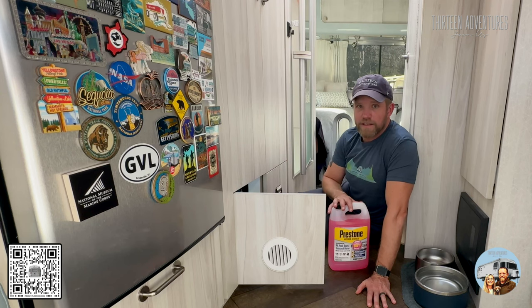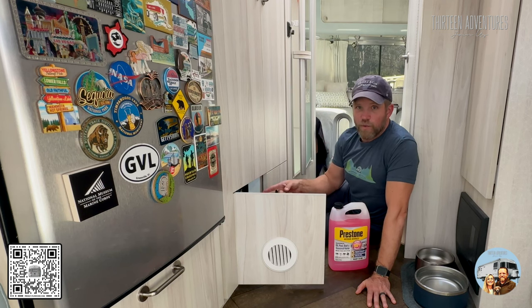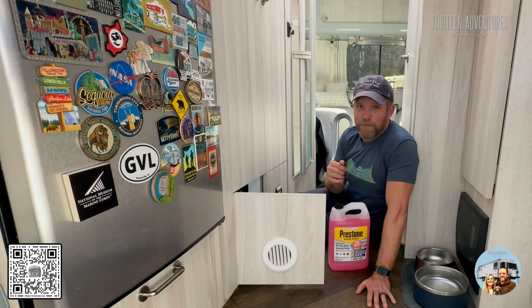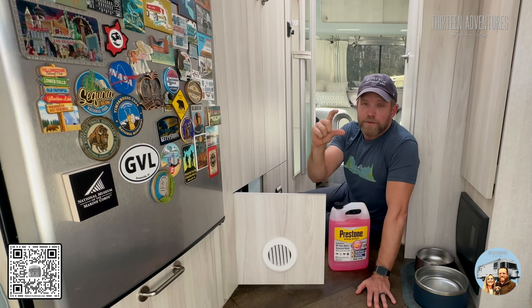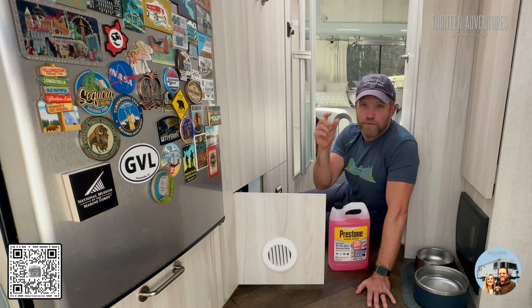Antifreeze, as long as your pump's working and you've got battery power, takes just a few minutes. I'm here underneath my hall closet because typically this is where your water pump is and where your winterization valve is. Some of you with an older model may not have a winterization valve built into your water pump, but it's a very simple thing to add. You need a three-way valve and a piece of tubing — cut your current pipe and put it in with some cheap components from Lowe's. In the show notes I'll have a link to our Amazon page with the winterization components and individual parts.